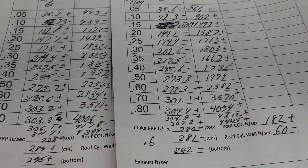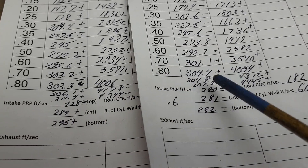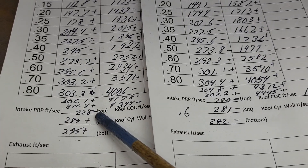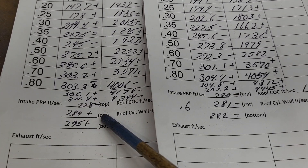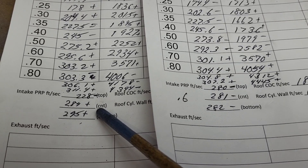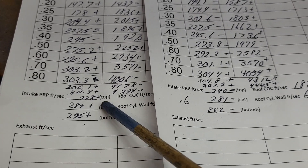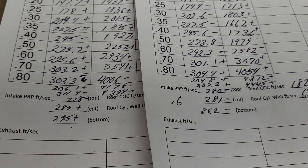It's the junk head right before I cut it for a 2.1 — I really want to squeeze the 2.08 as much as I can. As far as our pinch, it changed quite a bit: it went from 280 to 228 at 600 lift. The pinch was rocking fast at one inch — at 311 the pinch was 306 feet per second, so that is starting to cause a restriction at the higher lifts. I'm not opposed to taking some more area out of that; I haven't touched the center wall really, so we're good. We got a minus, plus, plus on our pinch.